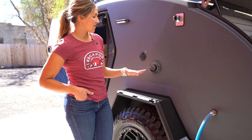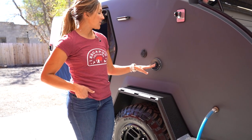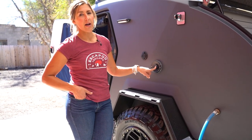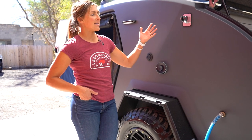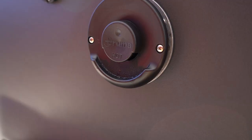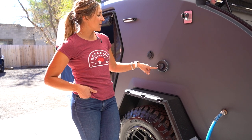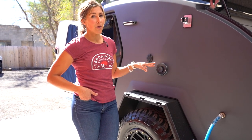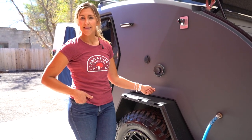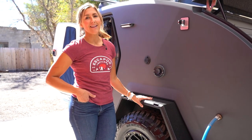To wrap up the conversation around the Truma in relation to hot water, you'll notice on the side of the trailer this unit here — this is both the intake and the exhaust for the air. As the water heater is heating up water, the exhaust is going to generate a little bit of condensation, so if you see some wetness here, it's nothing to be concerned about. This looks a bit more dramatic when camping in below-freezing temperatures because the condensation will continue to drip and you might see a little icicle develop off the side of the exhaust, but it is nothing to be concerned with.